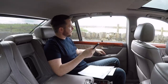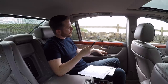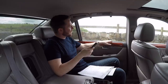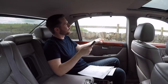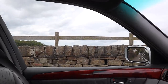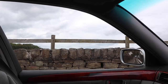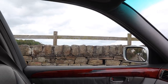Because the LS is so refined and over-engineered, it has double glazing — just like you'd expect at home — so there are actually two panes of glass. Over time they can start to leak, and moisture gets inside and it starts to frost up. That had happened on the nearside front window. I had some difficulty locating new front window glass, so I went onto eBay and found somebody breaking an old LS and got them to send me a nearside front window glass for £80 plus £20 postage and packaging. It was quite an easy job to fit.